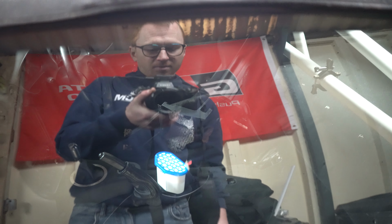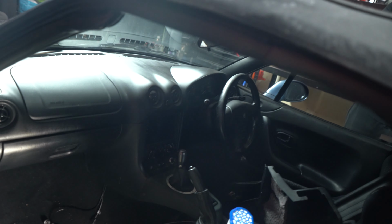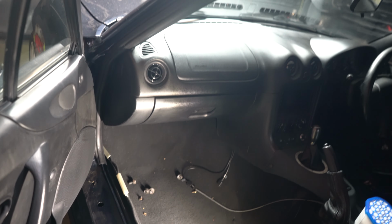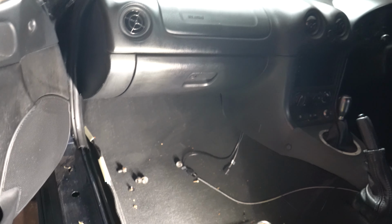Now that is accessible underneath the door card. If you remove the door card, you have 2 bolts at the top here somewhere, which are the end stops, and you can adjust them to give you a little bit more height on the seal up here. Obviously, as well, the rubbers could be perished, leaving gaps, so it's a good thing just to check those. I have seen some people say you need to lubricate them, but I haven't.